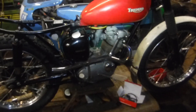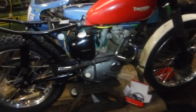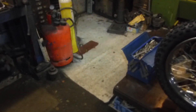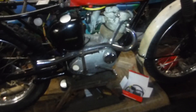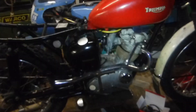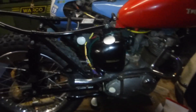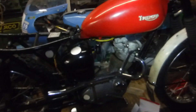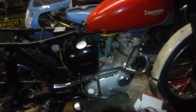Well hello again everybody. I think it's perhaps time for a little update on this Tiger Cub project I've got on the go. As you'll see this time, no battery charger, no wires leading remotely from the bike. It's all up and running under its own steam — got it going straight off the alternator into a combined regulator rectifier, which we'll talk about some more in a minute, and it's starting and running nicely.